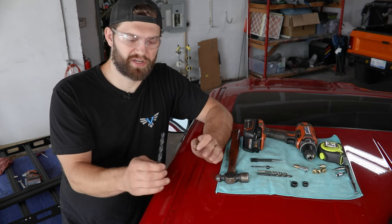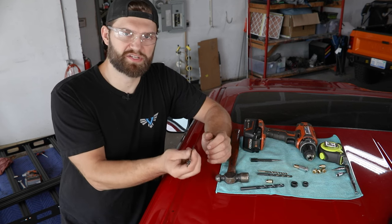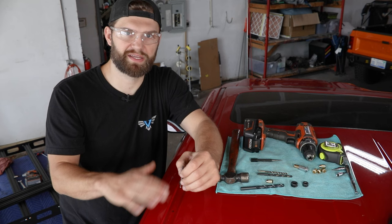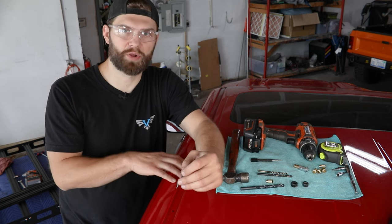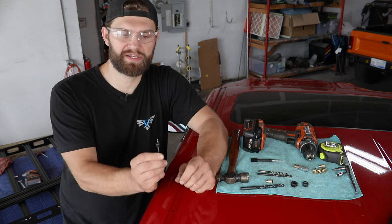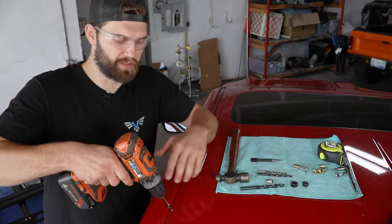For the drilling, we provide you with a bit to finish off at the correct hole size for the rib nut installation. However, you're going to want to start with a few smaller bits and step your way up, then finish out the holes with that size. We're going to start off with an eighth-inch drill bit. You'll also notice I have a drill stop — we're going to highly recommend you purchase some of these if you don't have them already, just to prevent over-drilling and damaging anything underneath. We had the headliner down underneath during our R&D process to identify appropriate hole locations, but if you go too far, the headliner is still under there. Set the drill stop with about a half-inch of stick-out as a pretty good starting point to get through the sealant and sheet metal, and then slowly drill out all eight mounting holes.